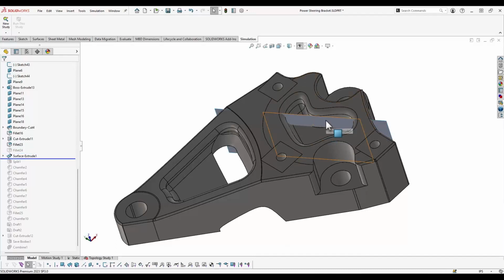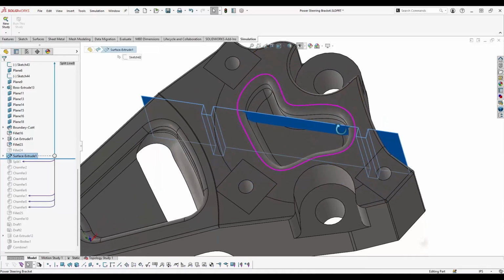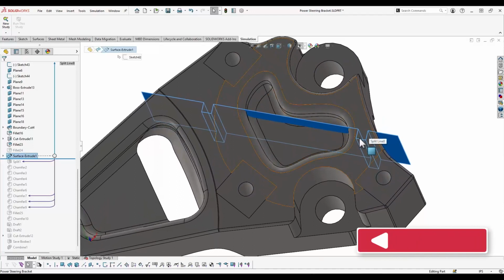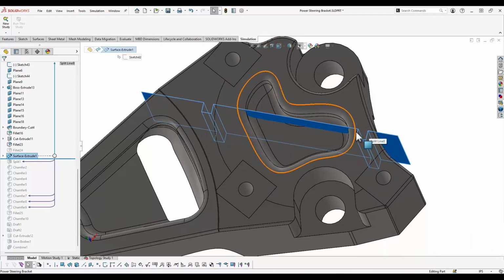We just created a simple surface extrusion here. That surface extrusion has some interesting features. You'll notice that it takes a couple of jogs and creates these little indexing sections. We'll talk about fixturing in a minute, but because we were splitting it up, we wanted a way to easily get these parts to fit exactly back together.